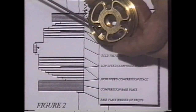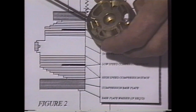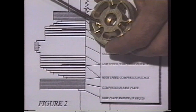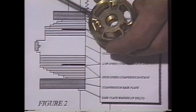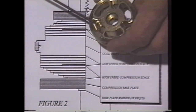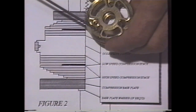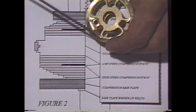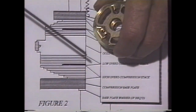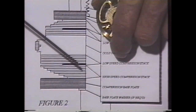Right here is a place where we actually have a jet for a bypass. Some of these bikes need a bleed — what we call a free bleed — which is just a hole that bypasses the valving. Most notably, we use that on Showa's, while the Kayaba design pretty much typically flows in both directions. When we were taking off the peening off of the end of the shaft, typical Showa's hold something on the inside of the shaft, while typical Kayaba's just hold it on the outside.